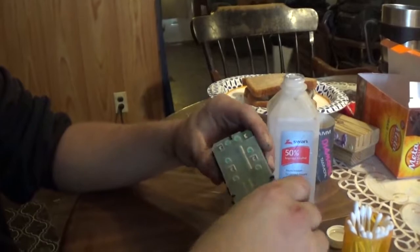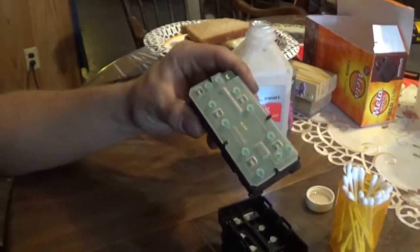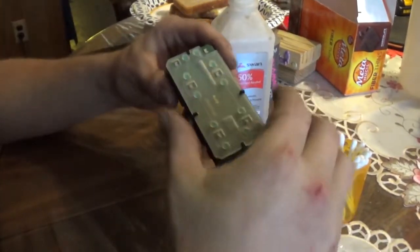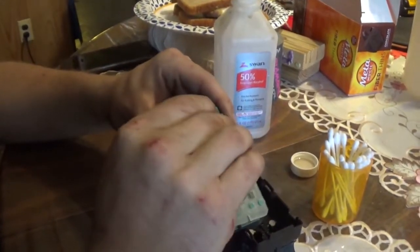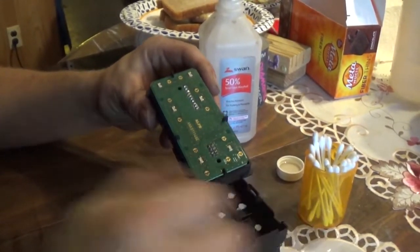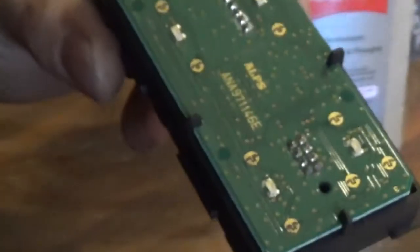Got it apart — it's just a series of those clips. This little white tab could be sitting right here; this is for the driver's side auto down. There's a little rubber diaphragm — simply take it off — and these are the contacts you're going to clean with alcohol. As you can see, look how dirty those are getting — that's causing the windows not to work very well.